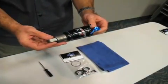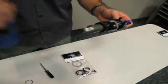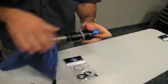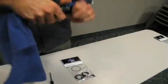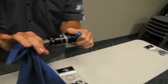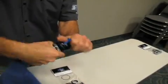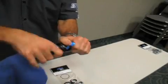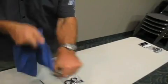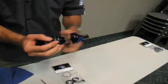When you take these apart if it's stuck down, make sure you take a shop rag — a cloth rag, not a paper towel, not a screwdriver, not your finger — but a nice cloth rag. When you unthread the air sleeve, if there's any trapped pressure in there, when you get to that last thread it's going to want to come off in a hurry and that rag is going to stop it safely. If there was any pressure left in there it would come off and make a little bang. We don't have a problem, so we can go ahead and remove the rag and take the air sleeve the rest of the way off.